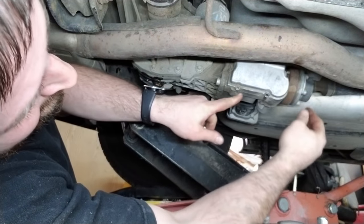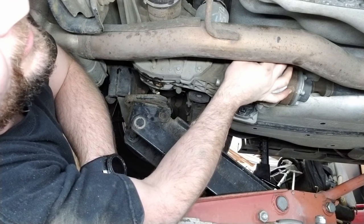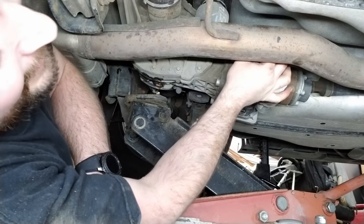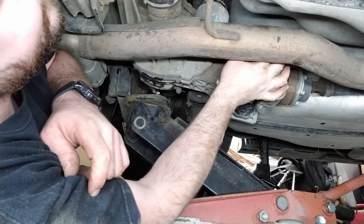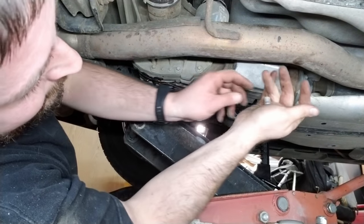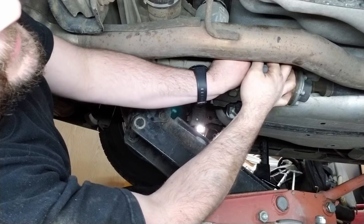That original one that was missing down here was actually used for the middle because I broke that last time. I thought the cover was stuck on because of the gasket. So I pried it off and broke the middle bolt. So do not forget the middle bolt. It's right in the middle of the cover. Just remember you have 10 altogether.